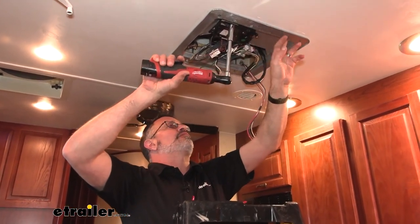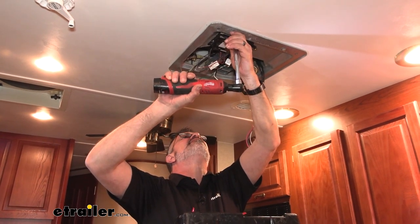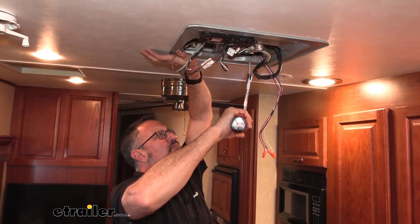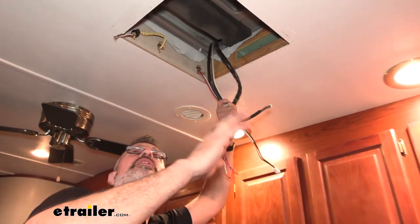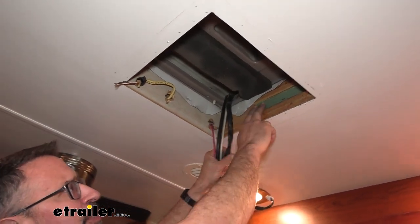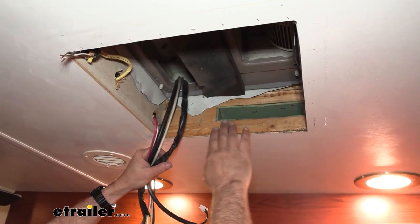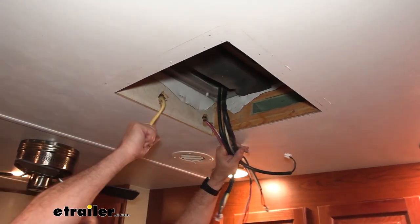I've got four 13mm bolts for this application, and I'm going to pull this inner plate down. We've got everything disconnected. Our next step is going to be going up to the roof and unbolting the unit, but while you're here, it's a good idea to check everything out. You can see our ductwork — your camper may be different, but inspect the ductwork and make sure everything's sealed; you're looking for leaks. This is actually the roof of the camper on this box on all four sides — just inspect the wood and make sure nothing's leaking. We look pretty good on this, so our next step will be to go up on the roof.